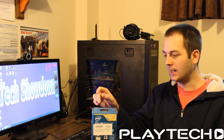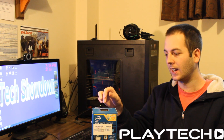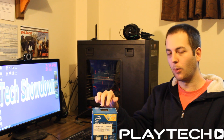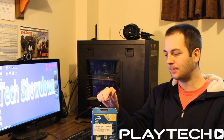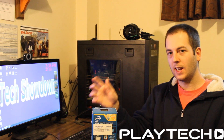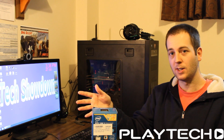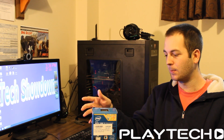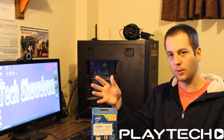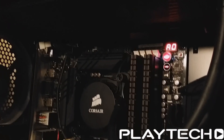With that being said, I set both of these to 4.4 GHz — which is the standard turbo for the 4790K but an overclock for the 4770K — and I set them both at 1.28 volts on the CPU core. Voltage is what generates heat, so setting them at the same voltage gives us the best comparison for temperature differences. I used the same thermal paste on both — Noctua thermal paste — and the exact same cooler, my Corsair H110.